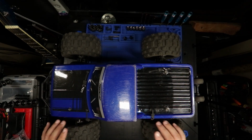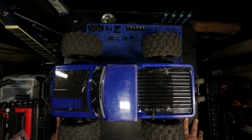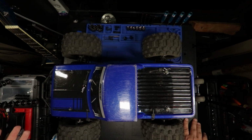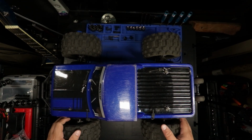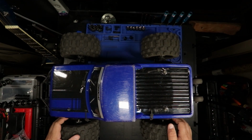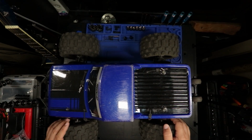That being said, once you're working on the truck, it's not really that bad because you almost always need to take the skids off, which are a majority of those 18 screws. For example, the center diff access is 18 screws, but the rear and center diff is 20. So it's the 18 plus 2 more. Similar to the front diff. Overall, it's a pain because most tasks require the removal of the skids, but once they're off, it's pretty simple and easy to get to everything else, with the caveat being the wires for the lights. They seem to always be in the way.